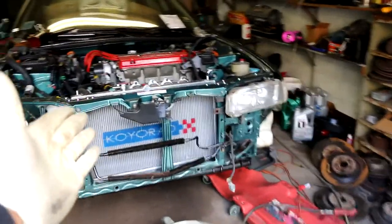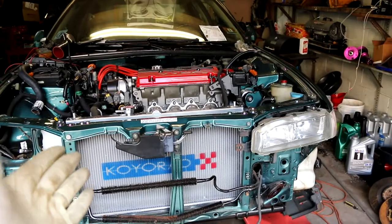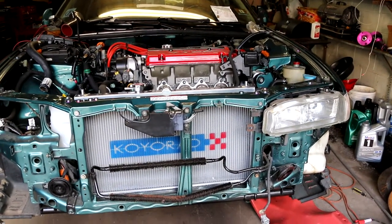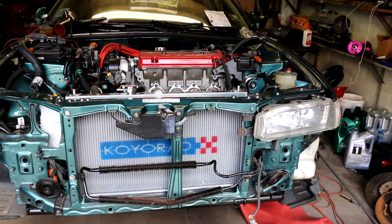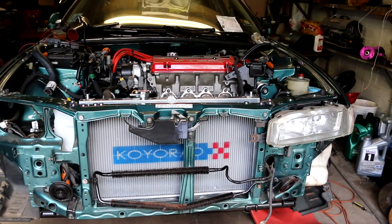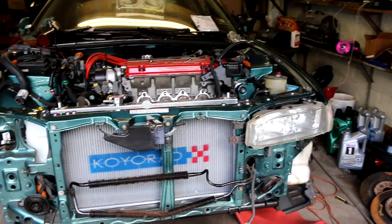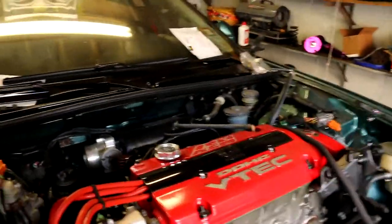What's up world. After initially starting the car I got a check engine light — I received code number 22 on OBD1. You have to jump a connector and then the check engine light will flash a series of codes to you. Slow blinks are the first digit and fast blinks are the second digit. It came out with the number 22.